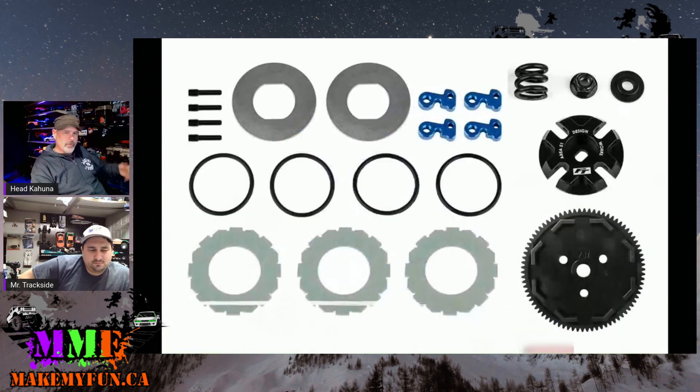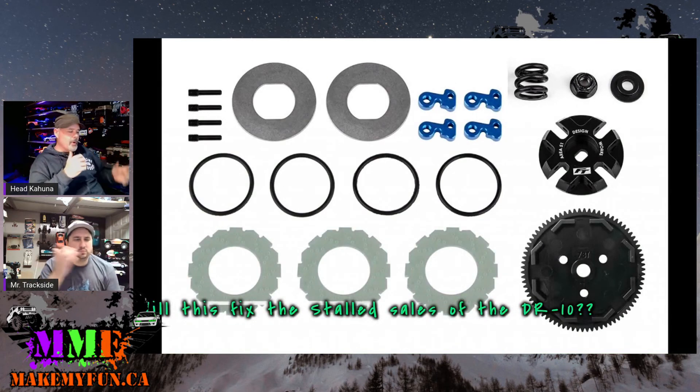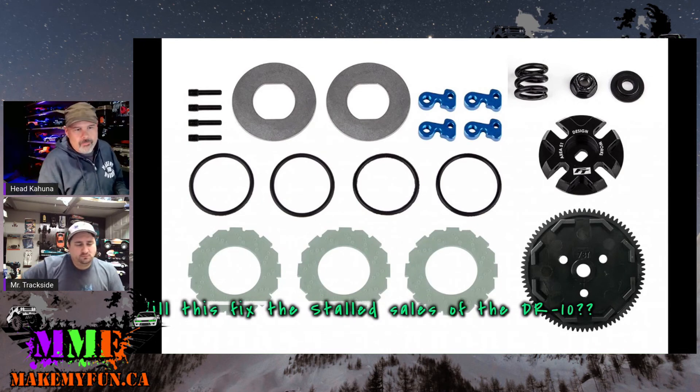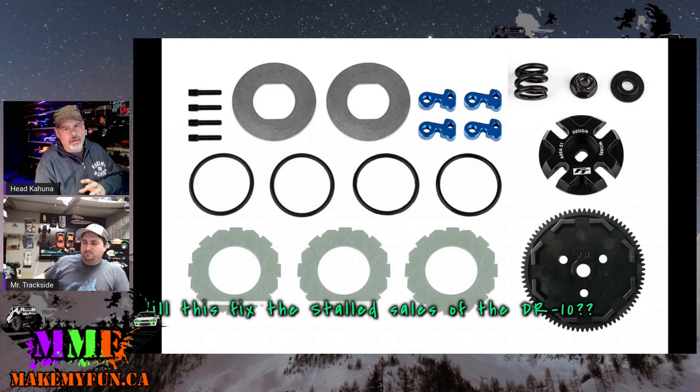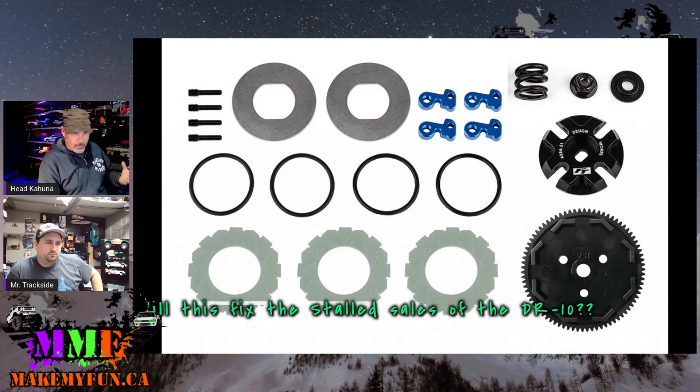It's a lockout slipper clutch and it comes with a full set of rubber. You can add weight into the dogs, and all those rings are a different durometer — a different tension. So if you want it to wind up a bit more and free-spin more off the bottom, like a stall torque converter, you change it up — put less weight in, change the tension. There's so much adjustment you can do. The risk is people are going to put this on a really cool car and mess it all up for weeks until they finally dial it in.